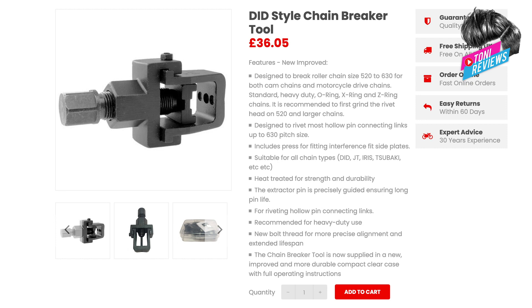If you're going to do the job yourself, make sure you've got all the tools required. You're going to need a grinder to grind off the front of the pins so that when you use your pin pusher tool you can push those pins out easily and the rivets can slide through. You'll also need the heavy-duty chain press, which costs about 40 quid — I'll put a link in the description. The kit from Square Deals was missing the press plate, but they sent one out straight away.